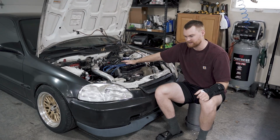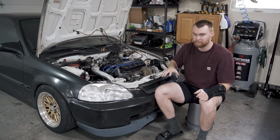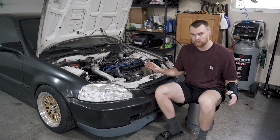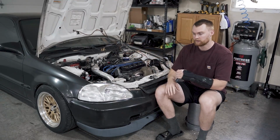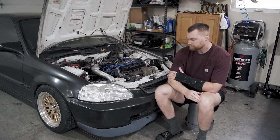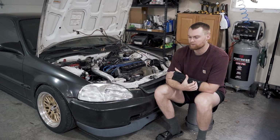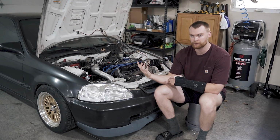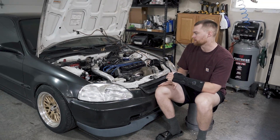I want to say like 160 or 180. And then we put Y8s in it, which are a little bit bigger. Nothing crazy, just a little bit bigger. Now keep in mind, while I'm doing all this, stock ECU, no tuning. It's all just plug and play, which is awesome. So I put the Y8 injectors in it, and it ran extremely rich at this point. The car was still driving good, but according to my wideband gauge, very rich.